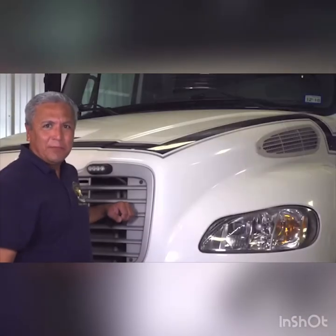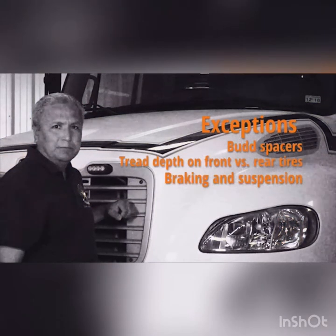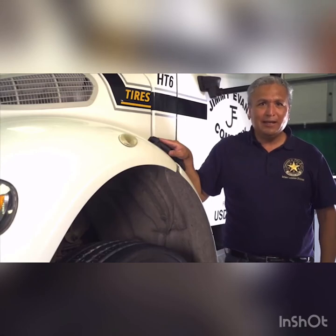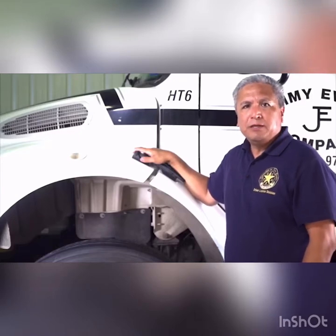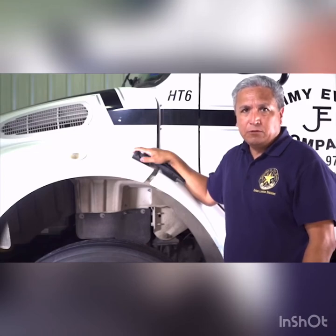This section covers tires, rims, suspension, and brakes. A tire inspection includes tread depth, condition, and inflation. If these are not properly monitored, it could lead to tire failure, tread separation, hydroplaning, or affect the ability to turn the vehicle. For the purposes of this pre-trip examination, we will only examine one front and one rear tire.